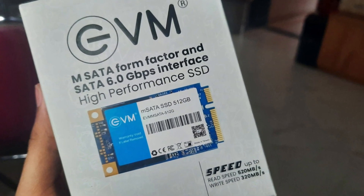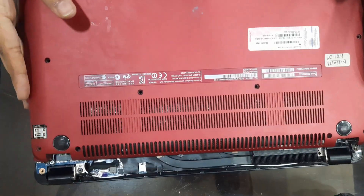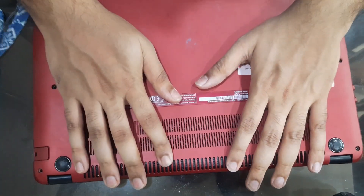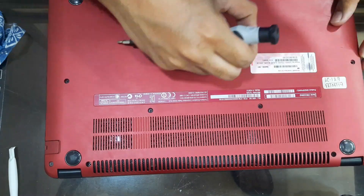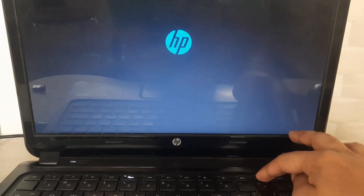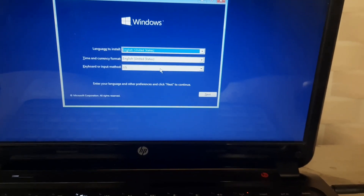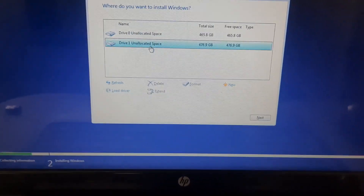Another upgrade added to this PC is an mSATA SSD — a 512GB SSD — to make sure this laptop runs a whole lot smoother and faster. I forgot to record that part, so I am just putting up images on the screen. Now we are going to close the laptop. So we want to plug in our install USB and press the F12 key. When we come to the installation window, you know the drill — format the SSD and the HDD as two separate drives.